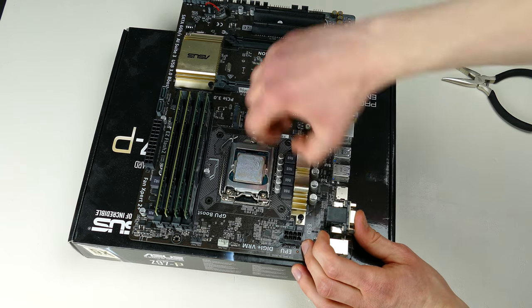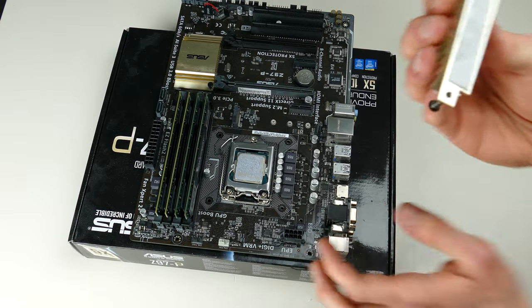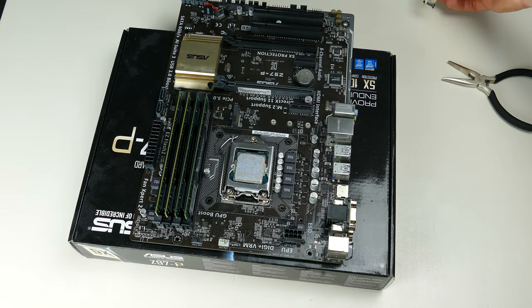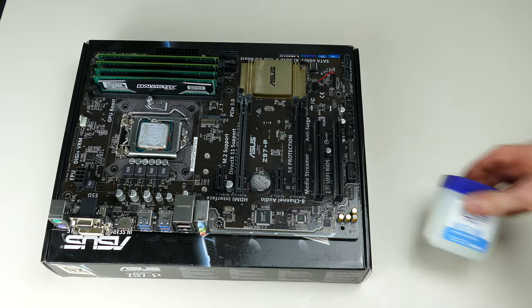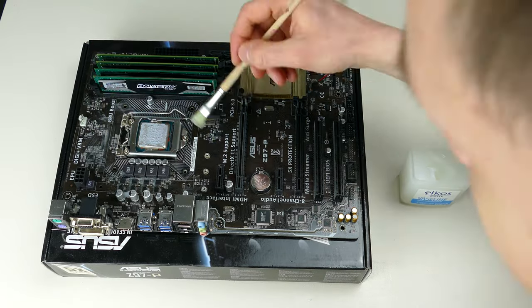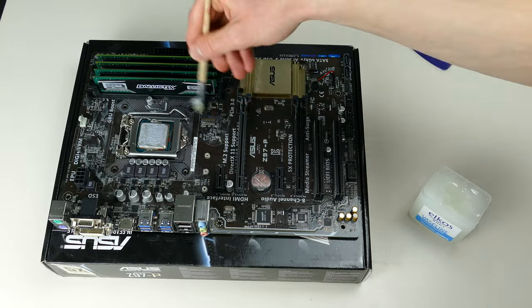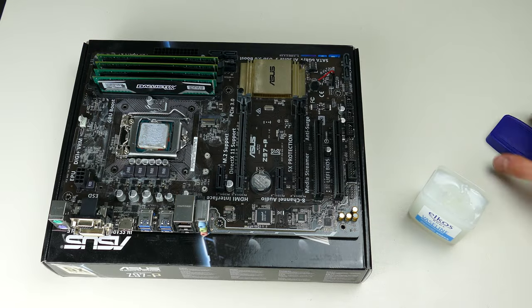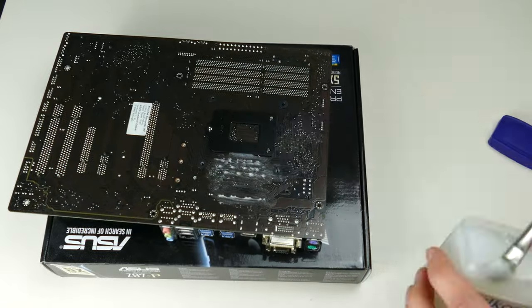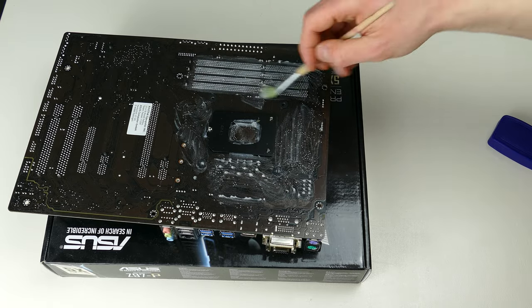Although dry ice does not conduct electricity, the moisture out of the air does. Ice will form and potentially melt on the mainboard once the temperature sinks below the ambient temperature. So a coat of Vaseline has to be applied around the area of the CPU and backside of the mainboard to prevent shorting out components. Be sure to also get it under the VRM heatsink. We can leave this heatsink off, the dry ice will cool the MOSFETs through the mainboard.